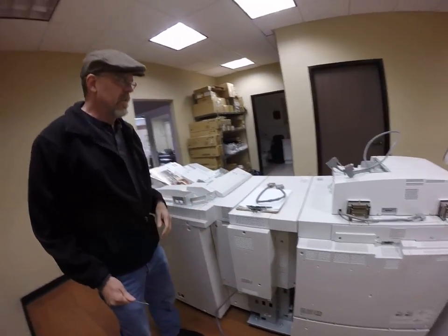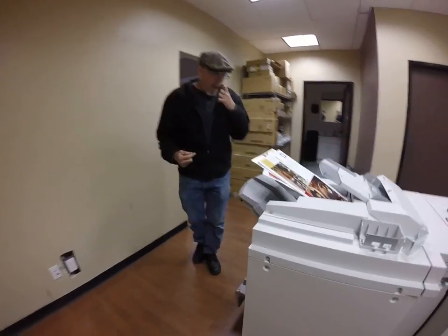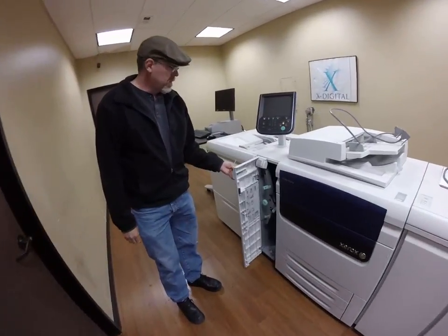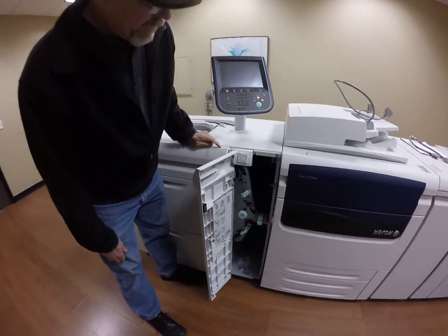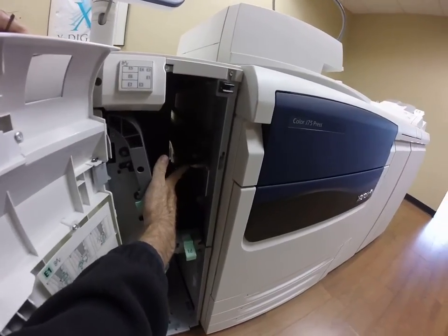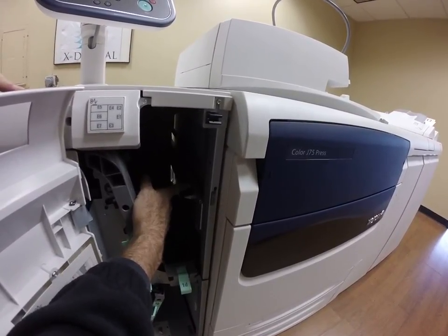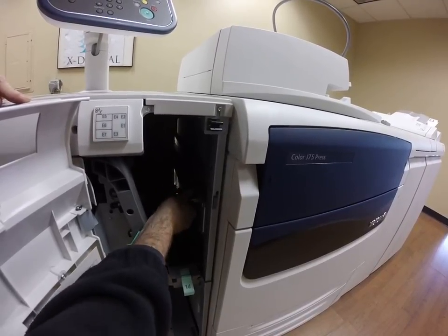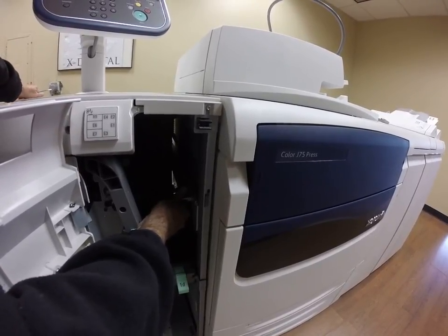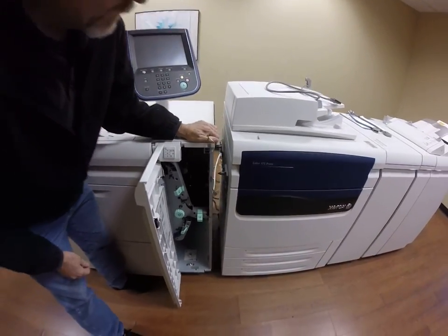Now we've handled all the connections on the back side. We'll walk back around to the front and we can disconnect our modules. We can start all the way over here with the feeder. We open up the narrow door here, adjacent to the printer. There's a rail with protrusions right here — on the rail you'll notice there's a piece of metal with a little hole in it. This is actually a catch, and if you press in on it firmly, it releases or undocks itself from two pins. With it held in, you simply give the feeder a little nudge and it comes off of the printer.